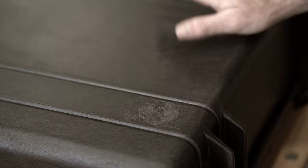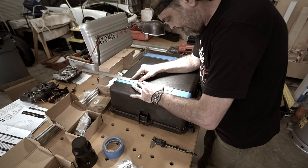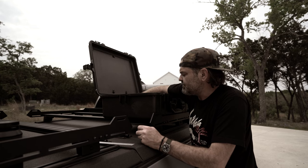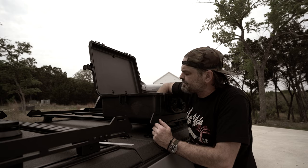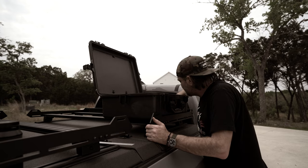Here's the end result — it's not perfect, but you're never going to see this anyway. After taking some careful measurements and checking them twice, I drilled four quarter-inch holes to accept the carriage bolts that I slid into the 80-20 crossbars. Then it was just a matter of throwing the case up onto the rack and getting it bolted down. I'm going to use these quick thumb screws and just watch them closely — if they have problems staying tight I'll just get some lock nuts; it would be nice to be able to take it on and off easily. Right now I'm using fender washers on the inside, but I think I'll get some aluminum plate just to make sure there's no tear-out.